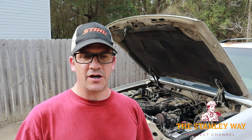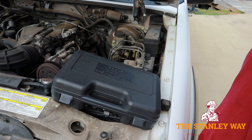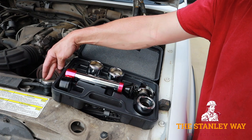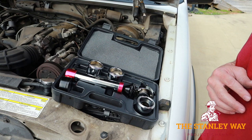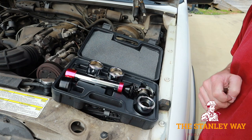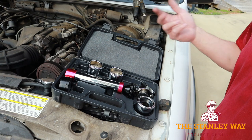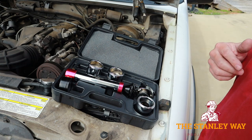What you can do is go to an auto parts store and rent a pressure tester. This one came from O'Reilly — it's got various adapters and a pump that allows you to pump pressure into the coolant system to make any leaks come out. Instead of spending $166, you go into O'Reilly, pay for it, they give you 48 hours to use it, and when you return it within 48 hours they refund the entire $166 — so you really can't beat it.